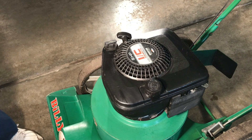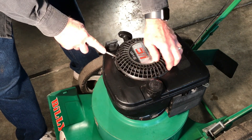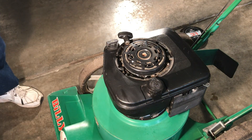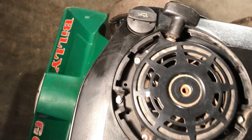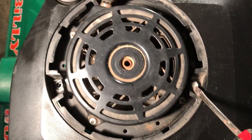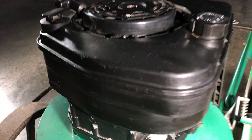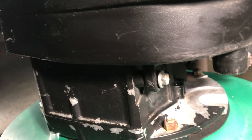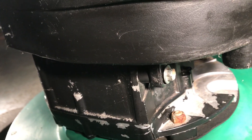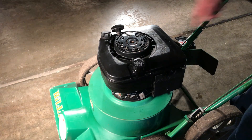If you're not familiar with this design, you pop the cover off the pull-start with a screwdriver — that comes off first. Next, there are three hex head bolts that hold the cover on: one here in the front, one near the back, and one underneath the pull-starter. To finish removing this gas tank cover combo, underneath the front and towards the bottom there's one 3/8 bolt that you need to remove.